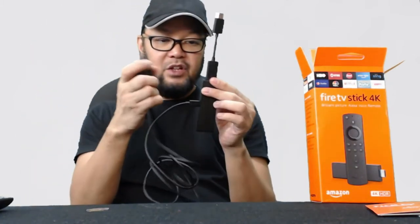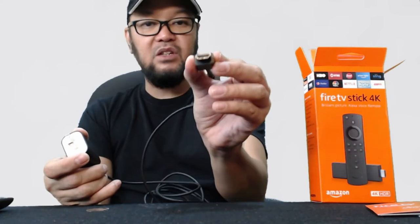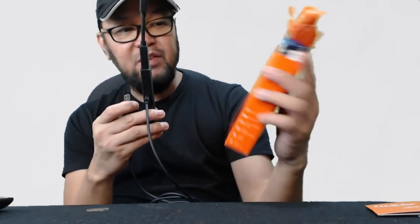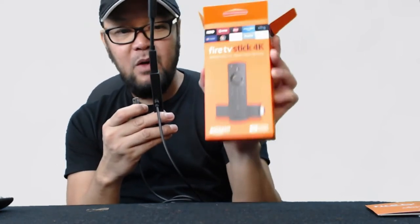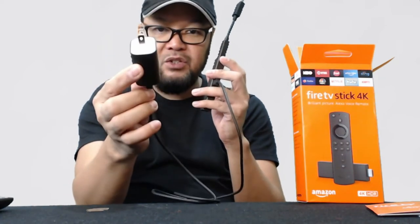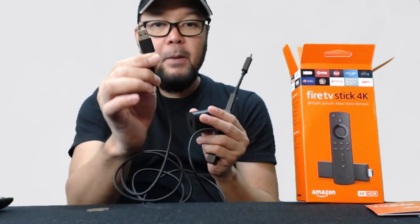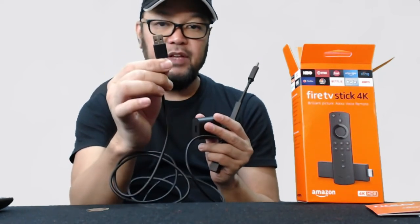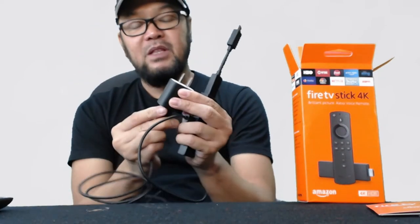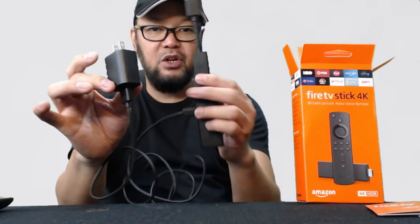This one goes to the HDMI port of your television — a smart TV or even just an ordinary HD TV — and it's even better if it's 4K because this Fire TV Stick is already 4K capable of showing 4K movies. Plug this to the power — I recommend plugging this to an extension cord or wall outlet. Do not plug the USB directly to the back of your television because it will work but it might damage the power supply of your HD TV. One of my TVs had its power supply break down from this.